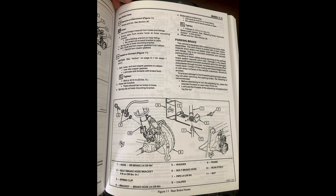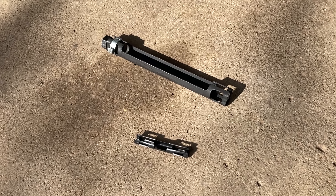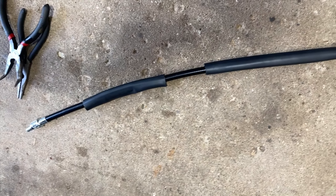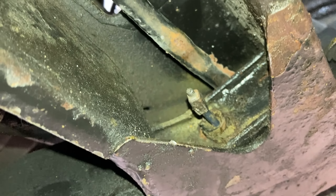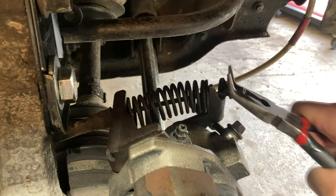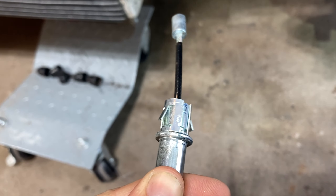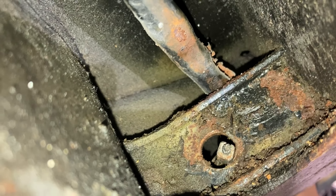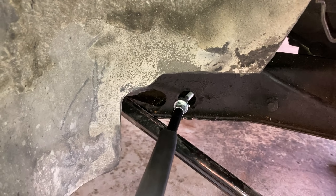Here's a picture of the service manual description of how to change the e-brake cables out. I decided to get all new parking brake connection hardware. These two connectors will connect all three parking brake cables — one to each parking brake and one to the lever. Now I'm going to repair my e-brake cable. The cable on the driver's side of the car has snapped off the end that is supposed to thread into this brake adjuster. Removing the cable on this side is pretty much exactly the same as the other side. Take some pliers and release the ferrule. You will have to take the spring off. There are several metal tabs sticking out that you will have to squeeze to release this cable from the bracket. Installing the new one is as simple as just threading it through the hole and making sure that the locking tabs snap in.